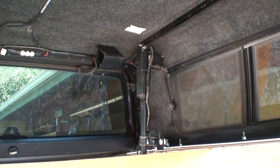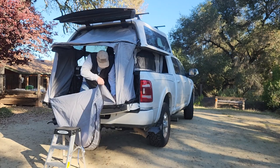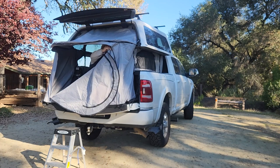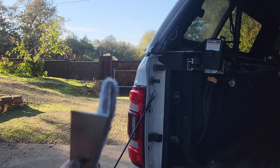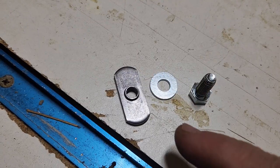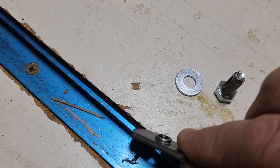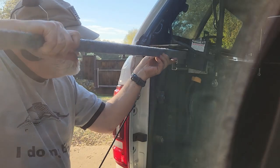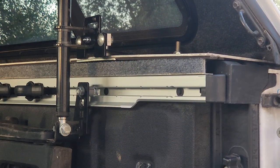The last customization was making the system ready for camping. The topper system can come with a tent option, and the components velcro onto the carpeted finish of the truck shelf. I glued some indoor-outdoor carpet to an aluminum angle for a base to velcro the tent to the truck. The carpeted angle uses a Ram T-track system with a standard bolt and threaded flat washer to slide into the top rack of the T-track system. The finished installation neatens up the components and can be easily removed when the shell is off the truck.